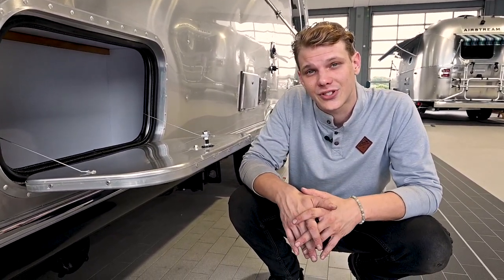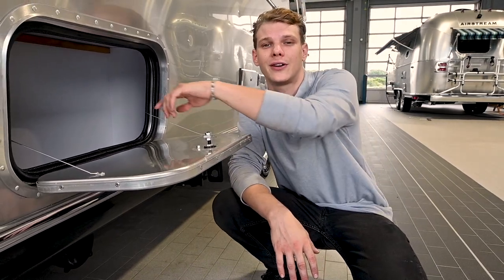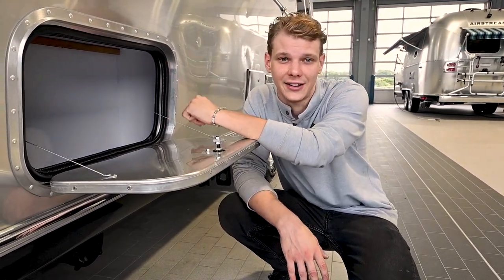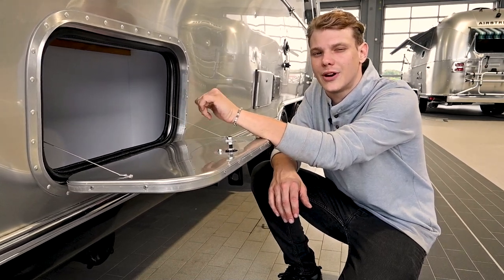When looking at storage compartments, just remember that these areas are prone to moisture buildup and surface mold since they are isolated from the main body of the RV. To minimize this risk, clean these storage areas regularly, clean your seals, and allow airspace between the stored items and the exterior wall to promote air circulation.